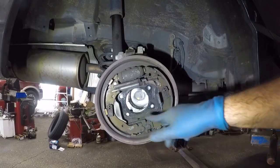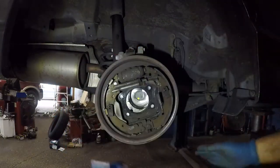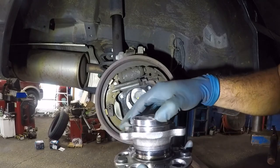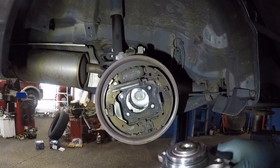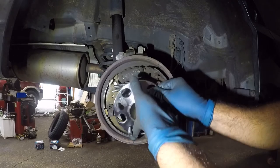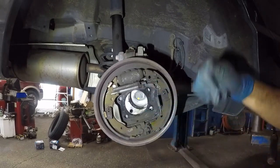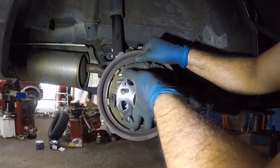I did clean it and put lube back there. Here's the new bearing — here's the part number on it. Inside the box you get the bearing and it comes with the little o-ring which goes right on there. Make sure you put this on — if you forget it you'll be doing this job again very soon. The flat surface of the bearing goes up on top. Also note the ABS sensor — the small black thing on the right side — make sure all dirt and debris is out because if not you'll have brake pulsation and the brakes won't work properly.